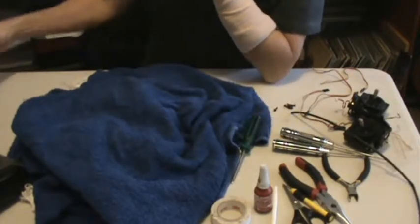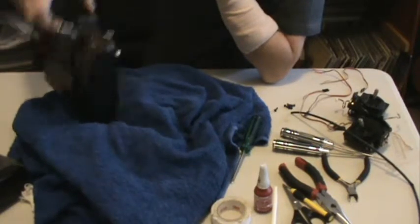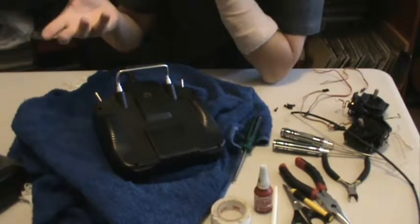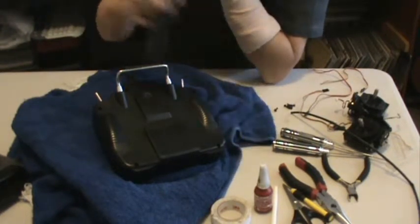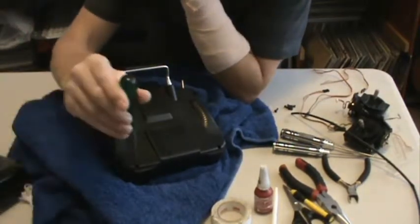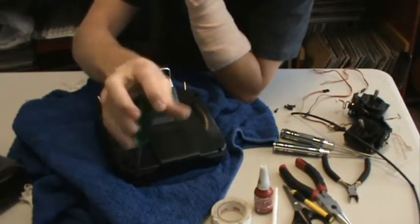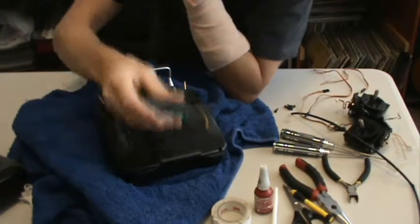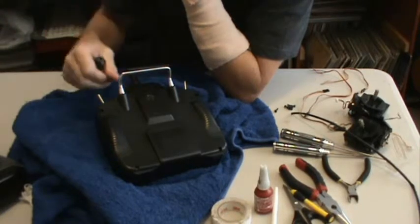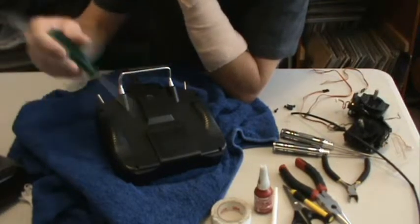The first thing you want to do is take the batteries out of the back of your controller, then place something soft down on your table so you don't damage any of your switches or sticks. You could also do it sitting on the couch with the controller between your legs if you feel comfortable, especially if you've only got one hand. Then go around and undo all of the screws around the back — most controllers have six screws all the way around.